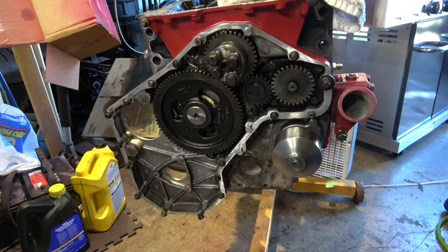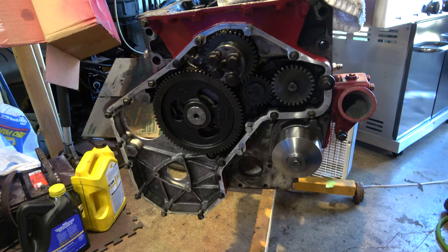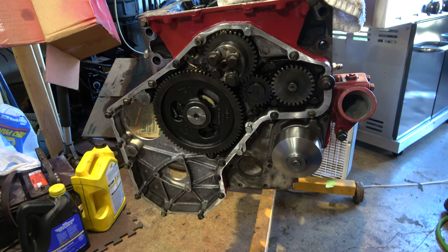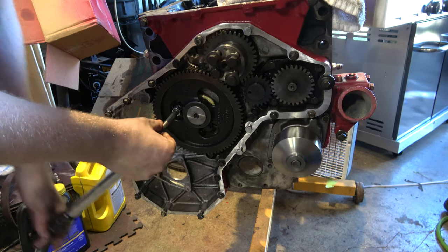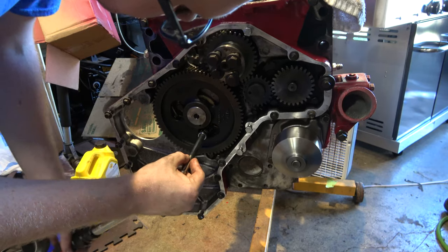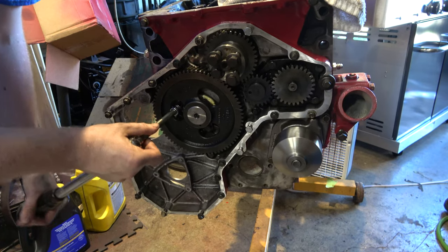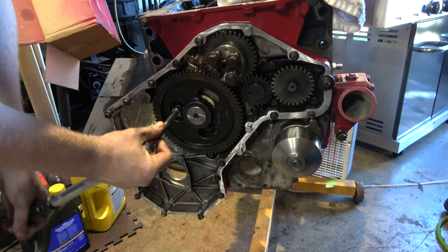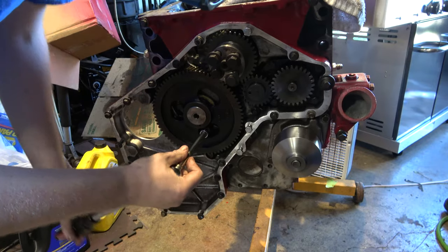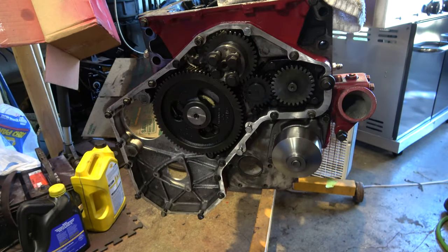camshaft thrust plate cap screws. Expecting this is a half inch. Oh, I need a short extension. Ah, there's my short extension. 20 foot pounds. Click. I like my Craftsman torque wrench, but this is just...